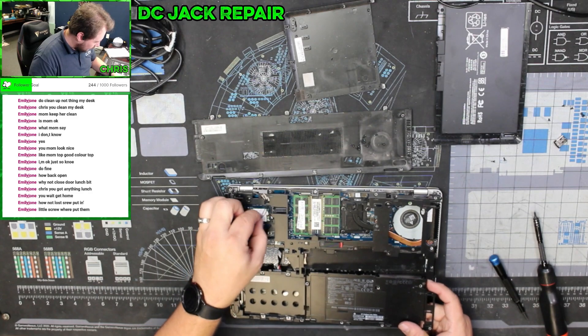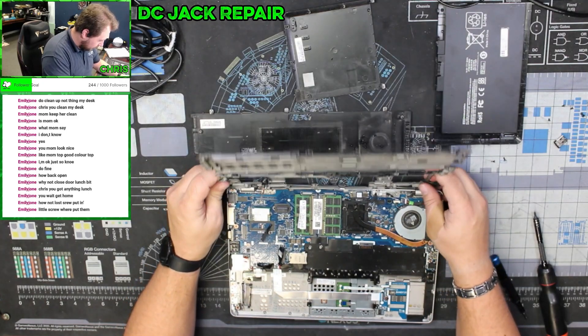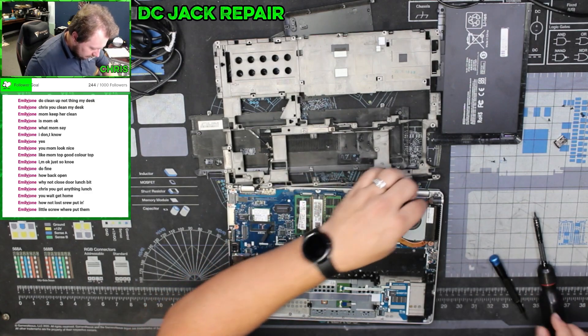This is back in an age when HP went really really overboard with what they were doing — unnecessarily large amounts of screws for no reason. One more screw here and then a couple more to take out. Those are all captive screws. Then we just disconnect our Wi-Fi cables, because we're not actually going to remove them — we're just going to flip this over. Alright, let's get a good look at this DC jack.